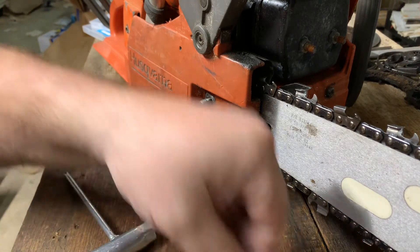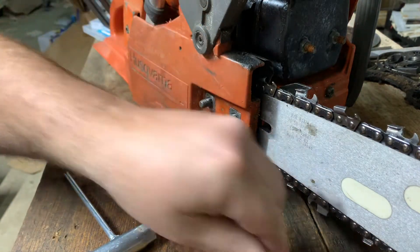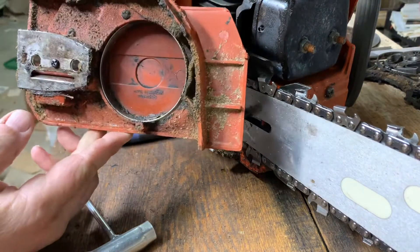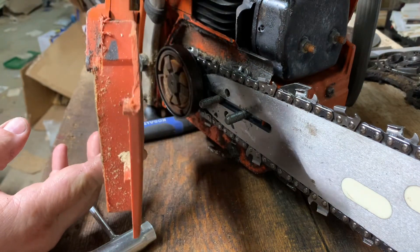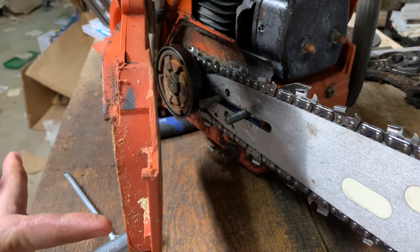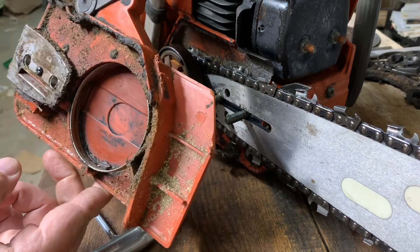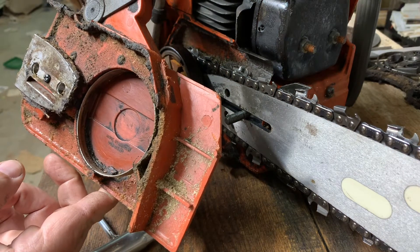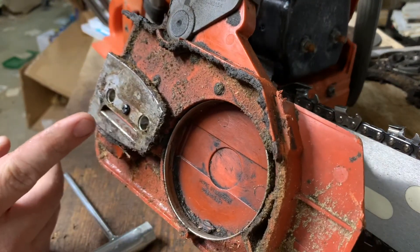This little homemade piece just kind of helps. With the 55 cover, you've got to do some pretty extensive trimming through here, and through here, and here to get this clutch cover to fit on a 262. It will work in a bind, so that's a good thing.